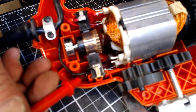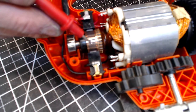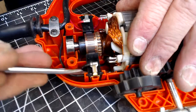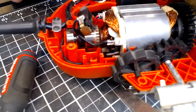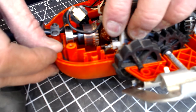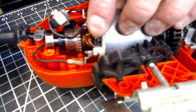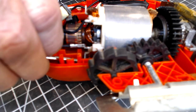So I'm going to guess our switch is okay. We can still test the switch if we want, but I'm going to guess that that's our problem right there — we need to solder that back on. The next question is how do we get down in there to do it? We're going to have to remove a few things so we can get the soldering iron down there. We've got some solder, we've got the soldering iron, so we're going to have to move some things around. I'm going to move this brush out of the way, and I might be able to lift that motor housing up out of there a little bit. Maybe I can just twist a little — right there.